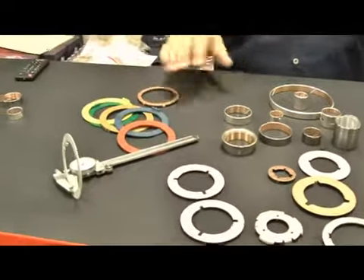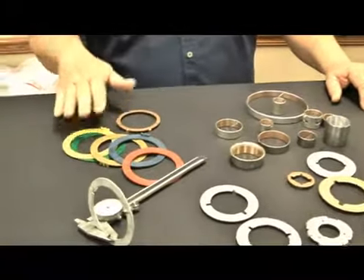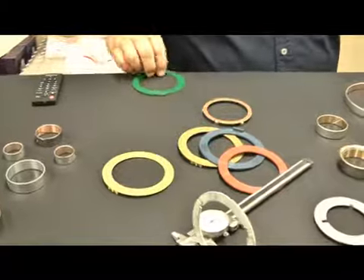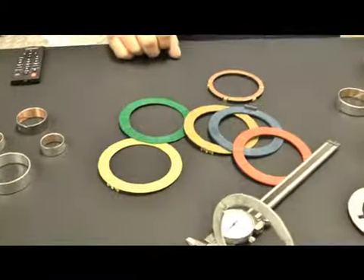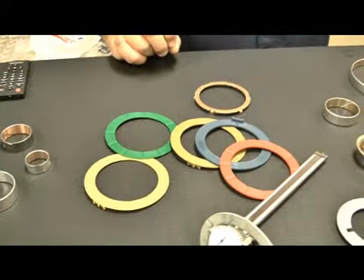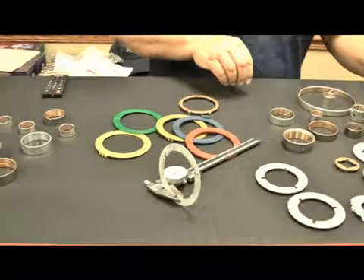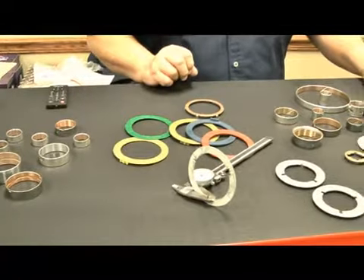Now, as you can see, I've got a selection of plastic washers here, some over here also. These washers are end play correcting washers. They do come in different thicknesses, and a lot of times they are numbered. You check your end clearance on a transmission and you select the washer to make sure that the end play is correct. End play specifications can be found in any of the rebuilding manuals, either through Motors or online, or any type of shop manual that has transmissions.